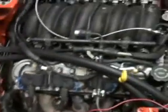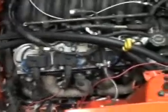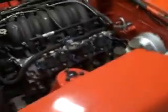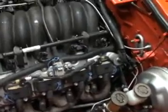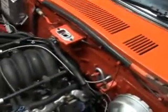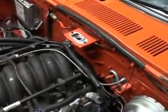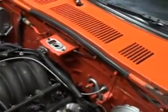It's a 2.5 inch system all the way around. It's true duals, if you want to call it. Everything's hose clamped. I use the Borla 400 by 286. Whatever you do, don't order it from Summit Racing, because they always back order it, and I waited like 3 months for nothing. So just order it straight from Borla, and it makes everyone happy. It's a little bit more expensive though, like 220. The muffler was a 2.5 inch dual in and dual 2.5 out with the built-in X pipe. So I killed 2 birds with 1 stone running that muffler.